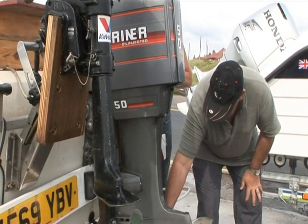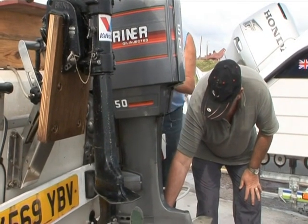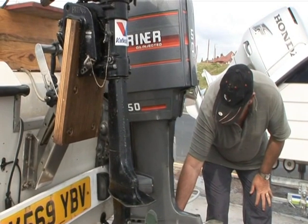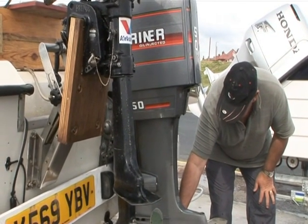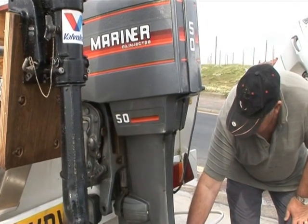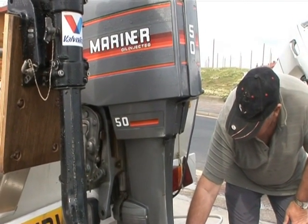This means no opportunity to hold the boat in the water and warm the outboard up. Warming it up out of the water at the top of the slip without a hose and earmuffs will damage the impeller blade tips, which can ultimately lead to engine cooling problems at some later stage. In any case, a few short bursts before putting the boat in is hardly a suitable warm up.